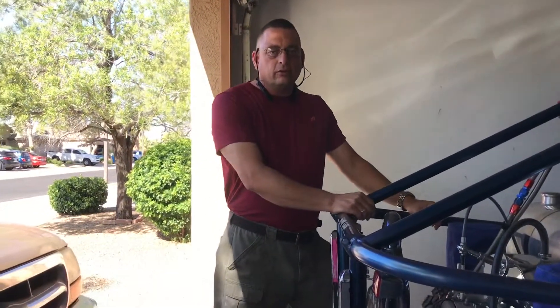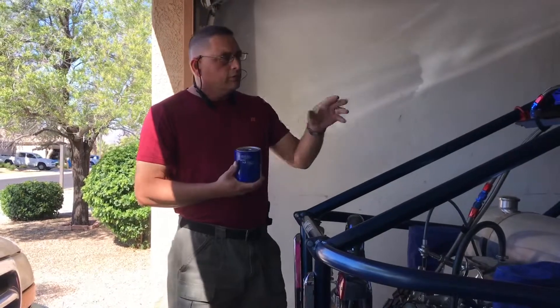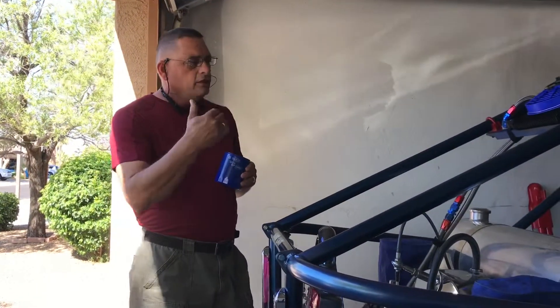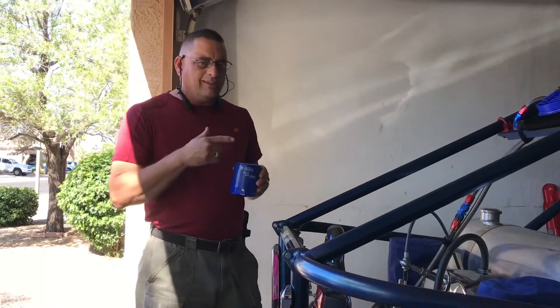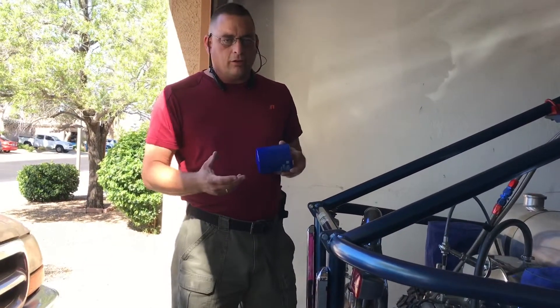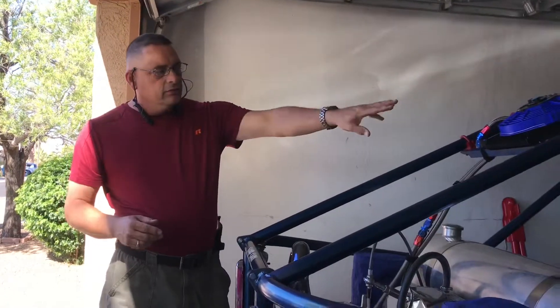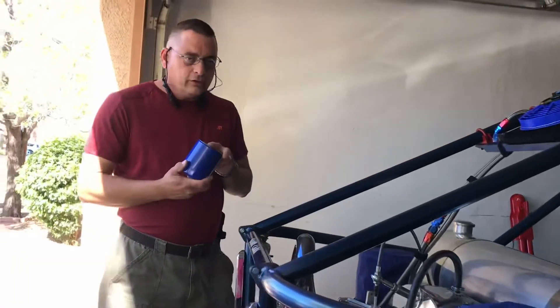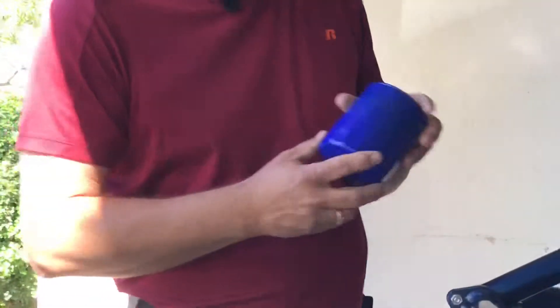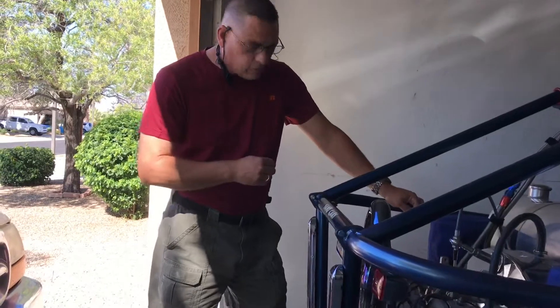Hey, welcome to Vic Ferrari's Garage. Today we're doing a full flow oil system. I'm going to show you how to hook up your filter, how to hook up your cooler, and get all the lines in the proper locations and connect them to the correct ins and outs so that you don't have backflow back into your engine block on dry startup. The system can hold — in nine feet of half-inch line, the cooler, and the oil filter — actually three quarts. So if you're going to wait every startup for that three quarts to get back through the system before it hits your bearings, you may as well just take your motor out and throw it down the street. So let's go over this real quick.